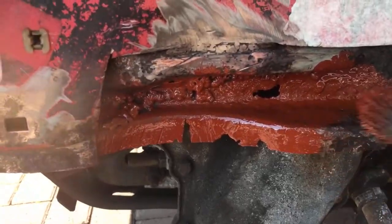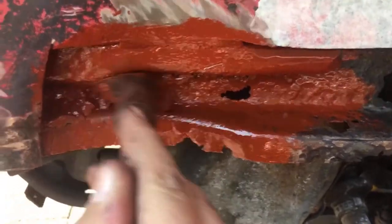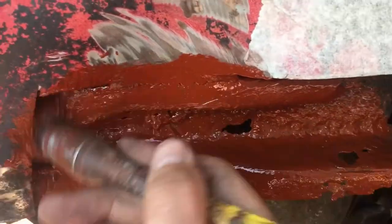Right now I'm doing the second stage — just red oxide. You want to apply this very liberally. Make sure you force it into all the gaps. See, that had a quick brush over, but if you force it in it'll soon fill all of them. So we're going to do all of this for everything I can get with the brush, and it's going on nice and thick.